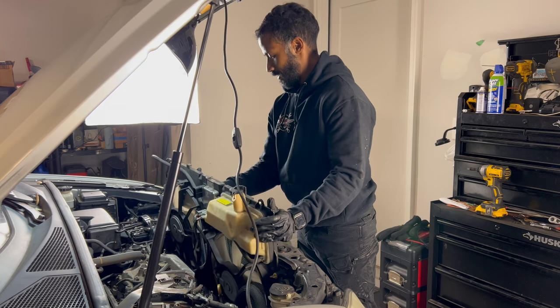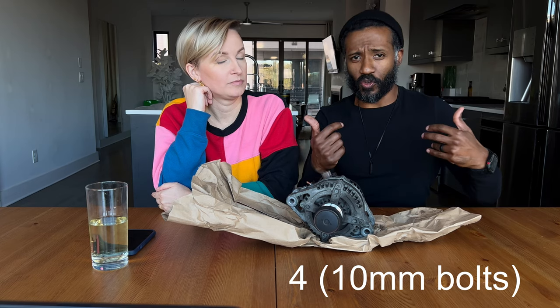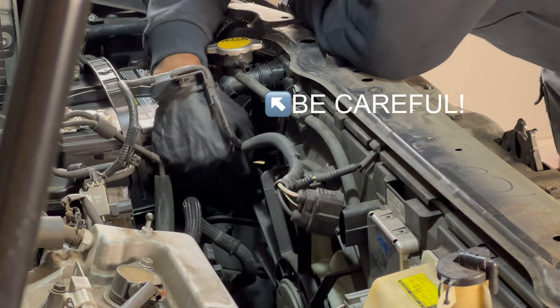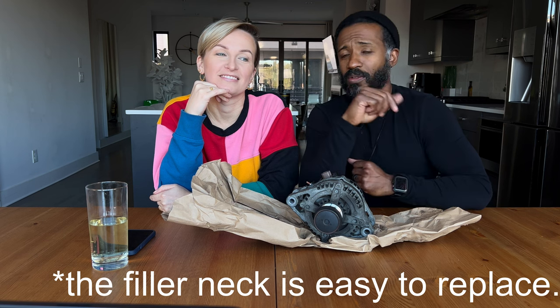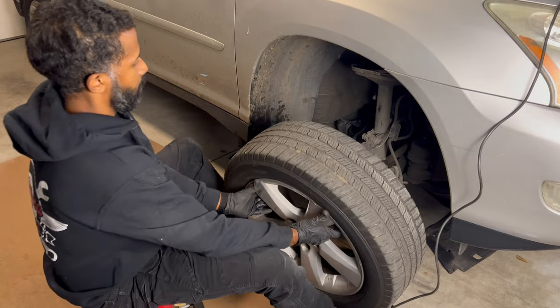You pull the plastic bits off first — everything was going fine. Then I went to pull the fans out, which took a little doing. The fans are only held in with four bolts but there are a lot of sensors connected that you have to undo, and you have to be very careful of the filler neck because on these cars the filler neck is very fragile and can break easily. Get all the hoses and electrical connections loose, then pull the fan out.